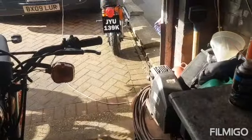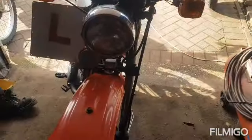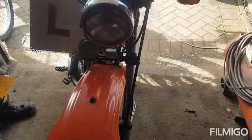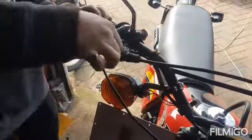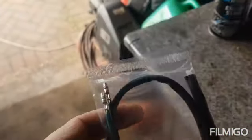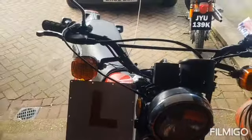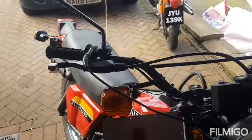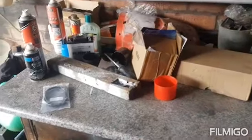I've left them to it. Oh yeah, there's my number plate I made. I've just done a little bit on Tom's bike because we've got no front brake switch in there to make the brake light light up. It's actually broken a little bit in there. Anyway, we've got a brand new one here, so we'll get that on. I think today, because I've been up here for a week and a half, we could do with a bit of a tidy up so we can carry on with the two XLs. Let's get this new switch in and get some video done.